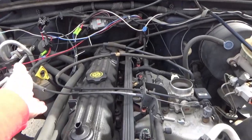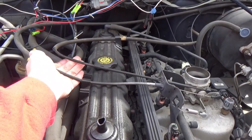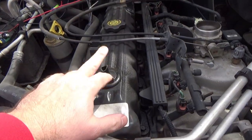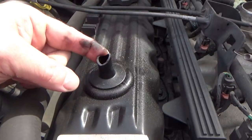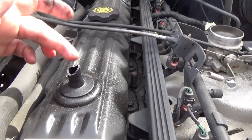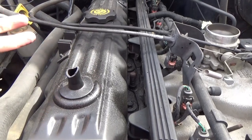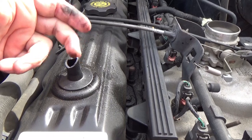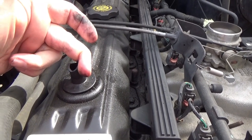After you get the air tube — by the way, you've got your throttle cables here. They just simply snap up off the valve cover, pretty easy. That snaps up over there. It's actually easier to come off the air tube. Look — it broke. That's not too uncommon because these engines go through heat cycles: drive it, it gets hot, it gets cold. The plastic oftentimes gets brittle. So we're making a run to an auto parts store to pick up another one.